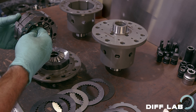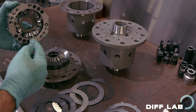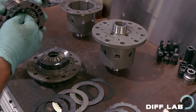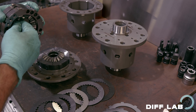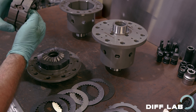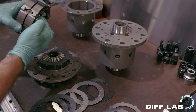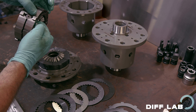When you lift off and the engine is dragging on the wheels, now the wheels are driving the engine — so it happens in reverse. These are driving the differential, and the capsule is connected to the engine, so now this is hard to turn. We're now working on these angles at the front, and you'll notice the angles are slightly different — these are more steep, that's the drive side; these are not as steep, that's the coast side. This is a 1.5-way differential, meaning the drive angles are not the same as the coast angles.